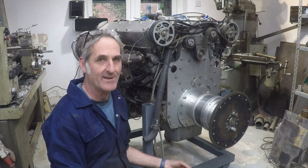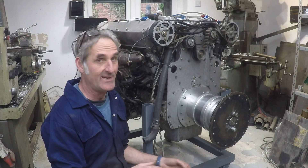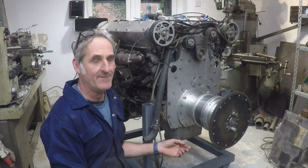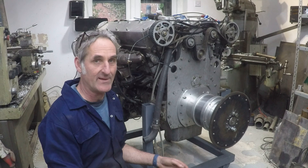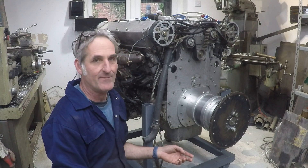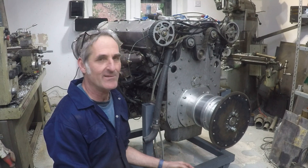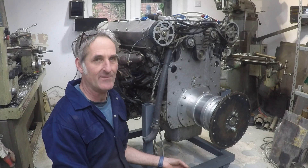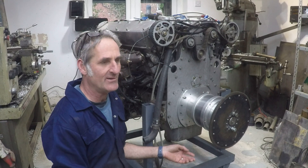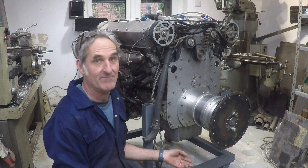The way vehicle manufacturers get over this problem is they put overdrives in the transmission, so the top gear — or the top two or three gears — put the output shaft of the gearbox faster than the input. The effect is that it brings the engine speed down when you're cruising, making it more economical and quieter. But going back to the 2500 foot-pounds of torque, the problem is you can't put that into any kind of car transmission — you're talking about heavy goods vehicle truck transmissions which are too big and too heavy. You can buy drag racing gearboxes that cope with those figures, but then you still end up with a top speed of 95 miles an hour.